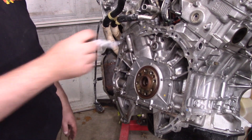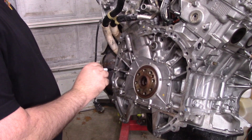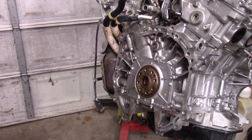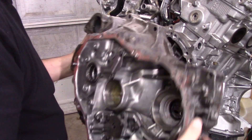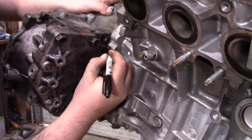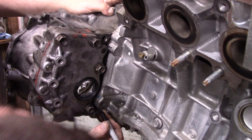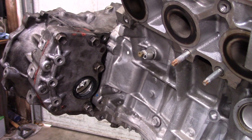There are a couple things that need clearance. Before we can do that, we need to make sure we have a dowel pin. You can see there's one in this location right here and one in this location right here — they can be in the transmission, but you need to have both of those. I've actually got the front half of the case to make this easier; I don't expect most people will have this, but it certainly makes the job easier. You'll see it doesn't quite clear — you'll want to make some marks right here and down here. This needs to be cut off, and right here. You can go from these marks to make at least your first attempt instead of throwing the transmission on there yourself.